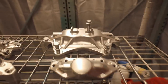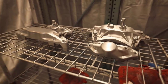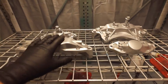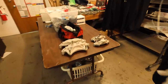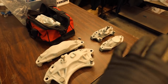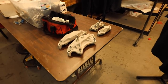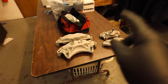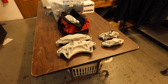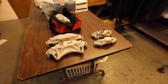Here's what the color actually looks like — this is called Porsche silver. It doesn't have heavy flake, which is what I wanted. This one has a little bit of orange peel — I went a little too heavy, but the clear coat should help clear that up. I want to get the silver base coat down on the remaining calipers before switching colors in the powder coat gun. I'm doing two base coats because brake fluid will eat through powder coat — having extra coats will make it more robust. I'll probably do two to three coats of clear coat as well.